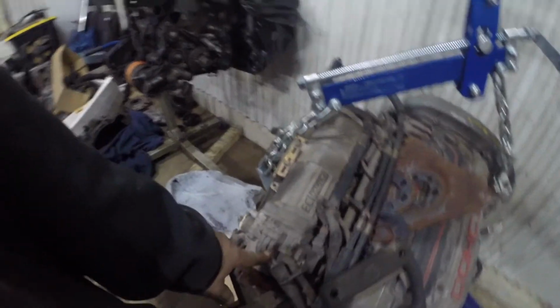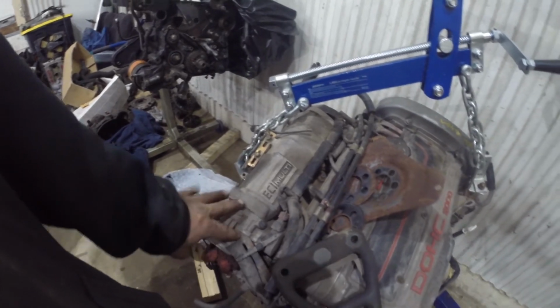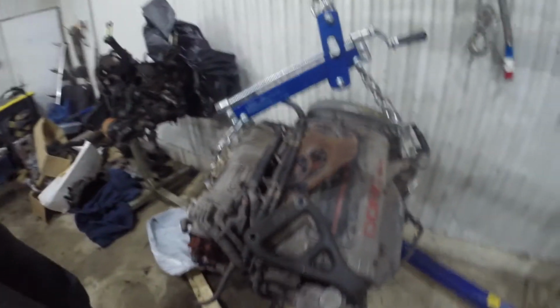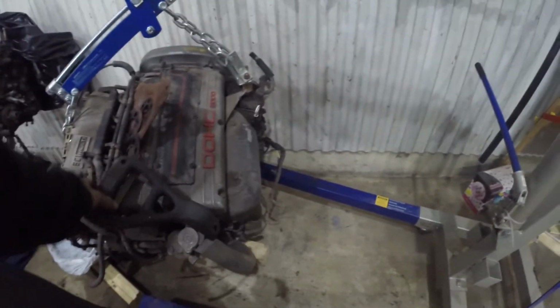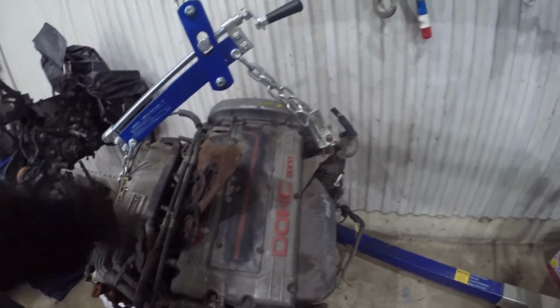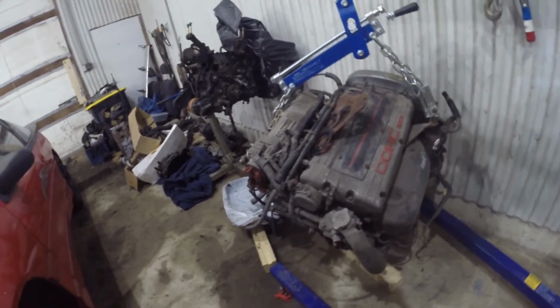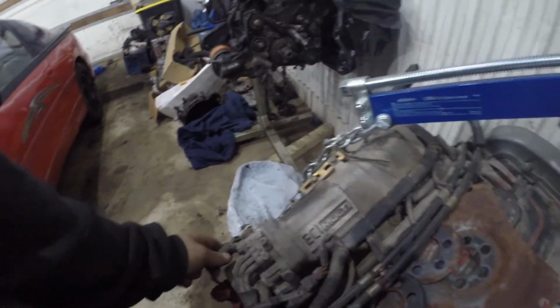The intake's gonna have to be changed, because the turbo's got extra vacuums. But in all honesty, I could just leave them, because every single one of those gets eliminated, I think, except for the one that runs the boost controller. It ain't even on this motor. The injector's got to be swapped. Polish the intake. Yeah, that's probably what I'm going to do. Boost tube's going to get swapped on it. Find a tire and put that engine down.